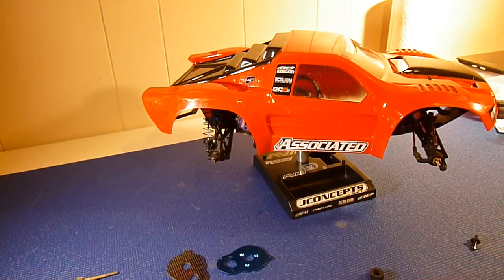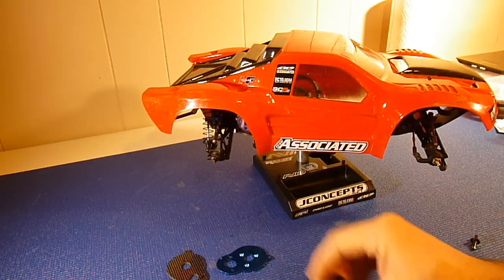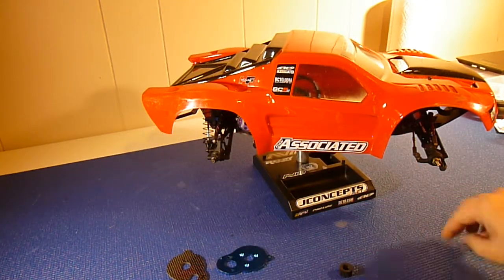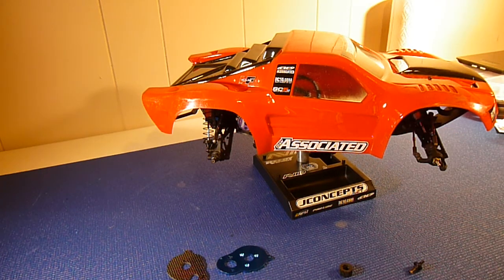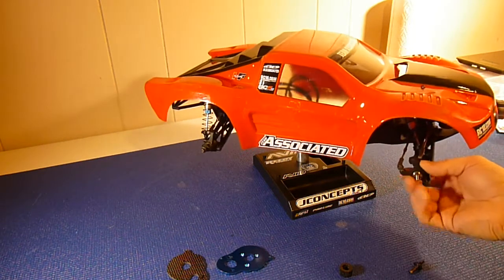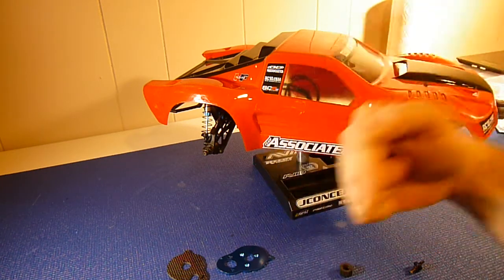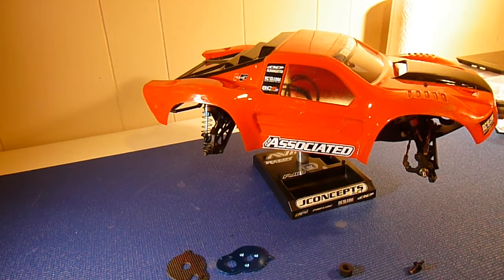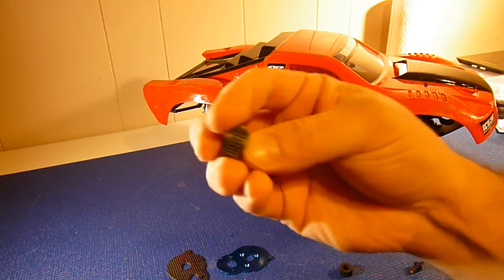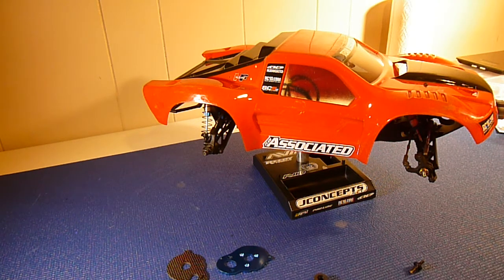Like I said, this is what I would do last. The first thing I would do is reduce your rotational mass — gears, top shaft, lug nuts is an easy one without breaking down your transmission, idler gears, axles are easy as well. Lug nuts and axles are probably the easiest, the rest is kind of in depth. Because if the motor doesn't have to work as hard to spin lighter parts, it can do it quicker and quicker. You do one of these things, you're probably not going to tell the difference, but you start doing a lot of them and you're going to start telling the difference — you're going to see how much quicker your truck is, how much faster off the line, especially compared to everybody else's.